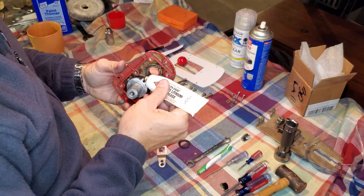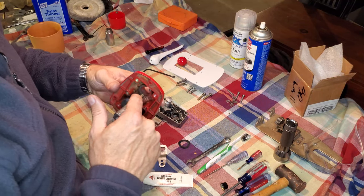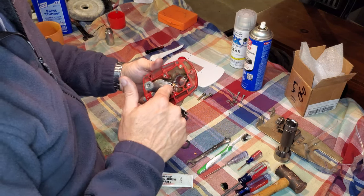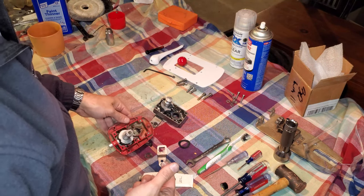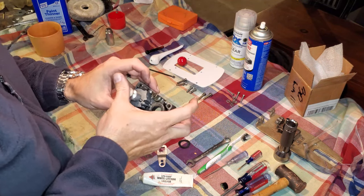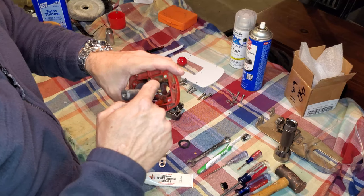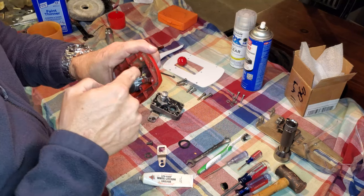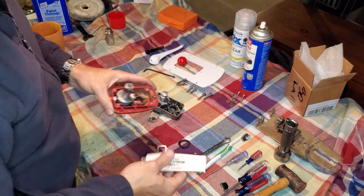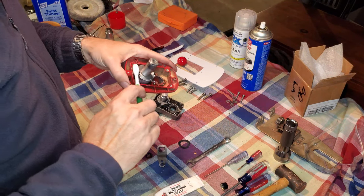So a little bit of grease goes a long way. And that's something that I have found over my maintenance and manufacturing years that too few people understand. A little grease goes a long way. When you're dealing with contact surfaces, mating surfaces, the grease can only lubricate the surfaces where they're touching. If you're putting so much grease on, as many folks do, particularly during a regular preventive maintenance when they're just ticking off their boxes and not actually paying attention to what they're doing, the only thing that does is make all the excess grease squeeze out everywhere and irritate the hell out of the next guy that has to come along behind and perform some maintenance. So don't be that guy.